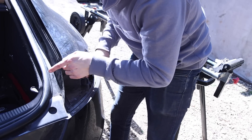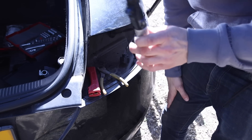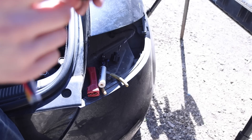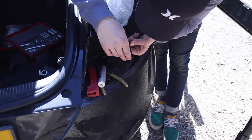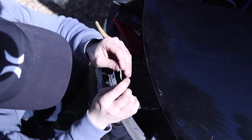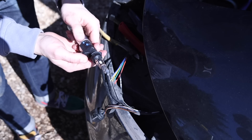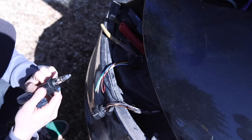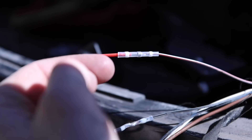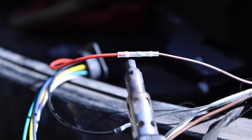If you're doing this yourself it really is minimal tools. I am going to disconnect the battery — some snips, wire strippers, and a mini blowtorch or soldering iron. Easier to show you on this one but there are numbers to each cable stamped along here. We'll just start at one and work our way around. I don't know if the colours correspond, so I am going to take one out at a time — put number one. Those wire strippers are not quite right, I've got a different set here. You can see the cables have both passed through the solder, joined in the middle — all we've got to do is heat it up. The heat shrink seals it from water and then the solder obviously gives you a decent joint.